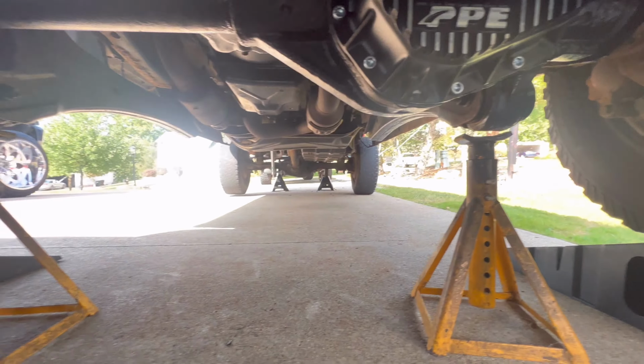You get your instructions for the rear as well. Same cross pattern, 1, 2, 3, 4, 1 and 2. You know, I might be doing it a little different. I was like, 1, boom. Just want to hit all the corners. You know, you want to do a crisscross pattern. Shows you torque specs. I mean, this is awesome, man. Color pictures.